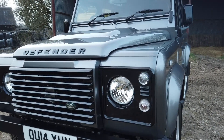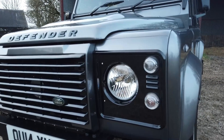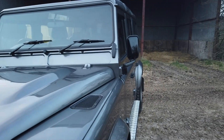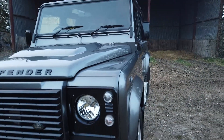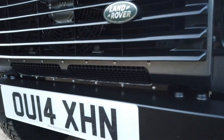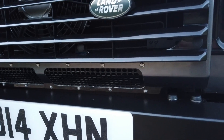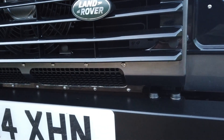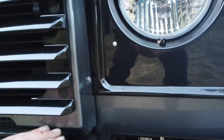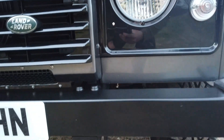Being an XS, it normally comes with Brunel grey grills and lettering, but they get lost on this paintwork, so we've had them professionally painted in Santorini black along with the letters — we call it the black pack. It looks really smart with the gloss black mirrors we put on as well. We also remove the lower grille, remove the pop rivets, powder coat, and fit a stainless steel replacement grille with stainless fixings, along with a brand new bumper with stainless bolts and ACF-50 anti-corrosion treatment under all those bolts.